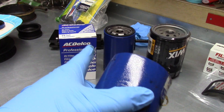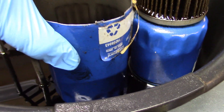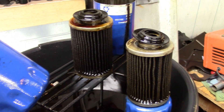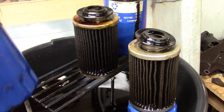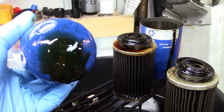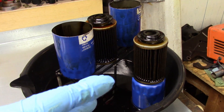I bought a case of these filters a while back. I should also mention that on my truck, they originally had shorter filters and I changed to these taller filters because they obviously have more filter material — they're going to filter better or last longer in my opinion. And if you are going to drain one of these with the anti-drainback valve, you may want to consider punching or drilling a small hole in the bottom so it'll drain better. There's room for improvement.